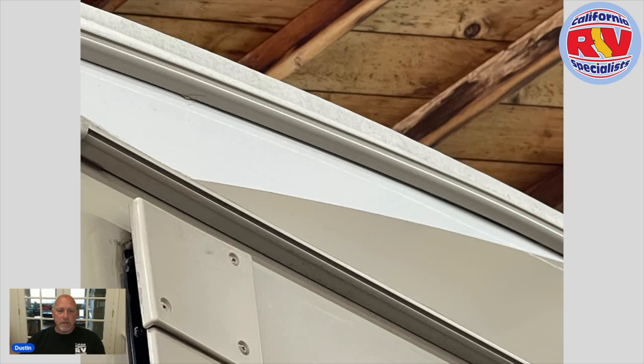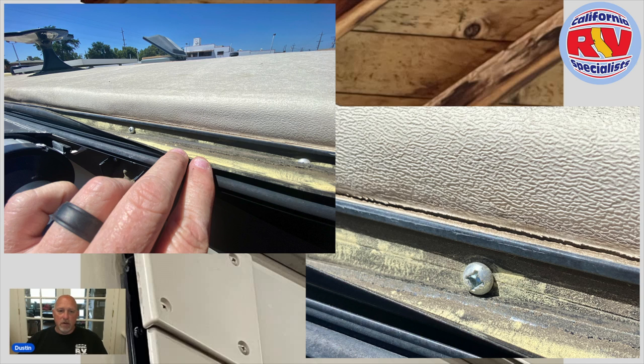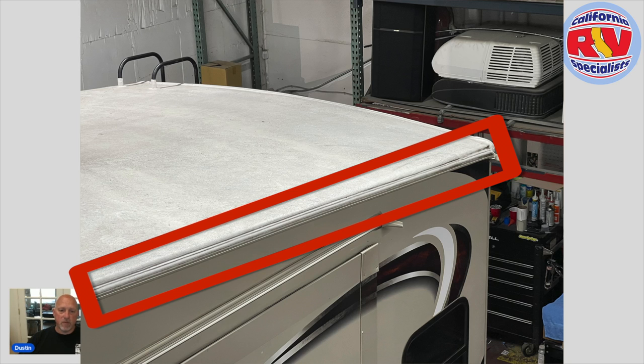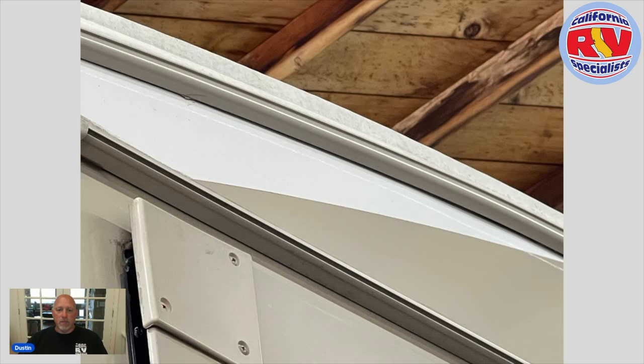Here's an example of the sidewall molding — as you can see the gap underneath it. When traveling in the coach or simply walking around if it's parked, maybe using your leveling jacks and stabilizing the coach, that side-to-side flexing causes those moldings to need tightening, and this molding is actually coming loose. Unfortunately, we're not going to be able to go in and tighten this molding because we'd end up causing damage to the actual roof material coated on the insert screw cover molding. If the putty tape bleeds out from behind it, that's going to compromise things with the gaps. If you pressure wash it, drive through a truck wash, or use a water hose, you risk getting water behind that molding and damaging the sidewall and roof line.